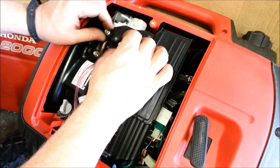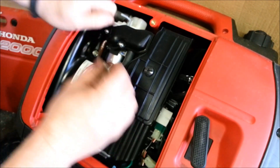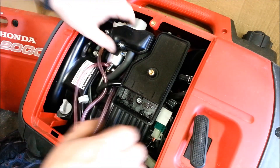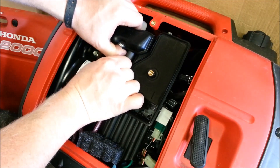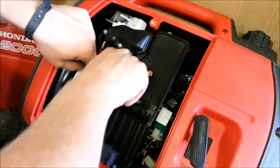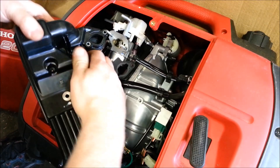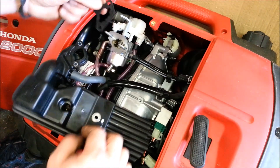Once you take the cover off, you'll have two 8mm bolts here. Then take off your air filter, which is right under here, and under the secondary part. This assembly pulls off the hose — leave it attached for now, it's stiff. We'll just leave it attached, but the hose just pulls off if you want. There's a little gasket there.